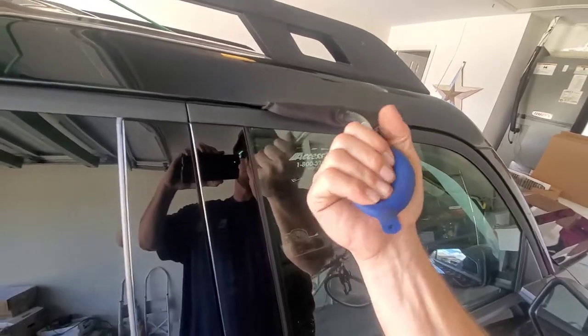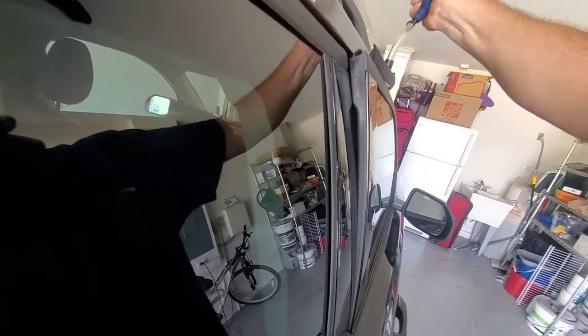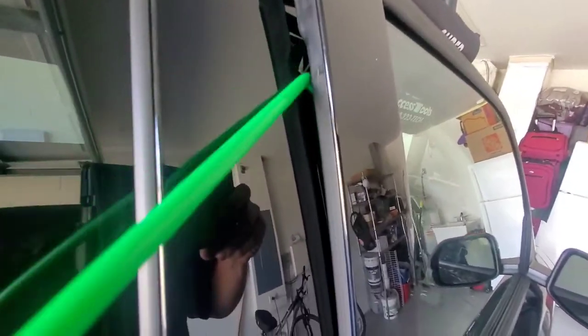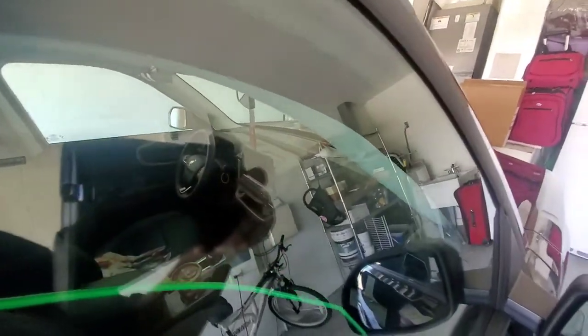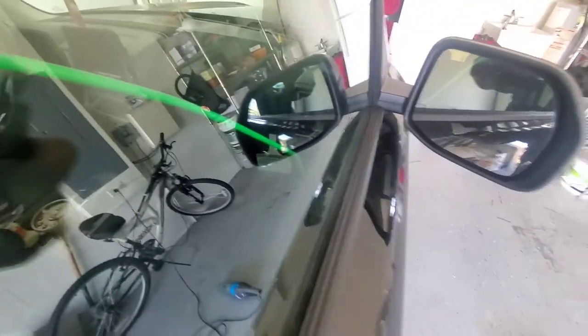Close your little valve here and pump it up. When you're pumping it up, it's going to start bending that door out — prying the door open for you. We're going to go maybe about a quarter to half inch right here behind the plastic. Once you can see a gap inside the vehicle, you know you're good. Then we take our reach tool with the rubber tip and guide it right through the door frame. It won't scratch anything or damage anything — it slides through effortlessly. We're going to come over to the inside door handle, hook it, then rotate the tool clockwise to hook and pull the handle.